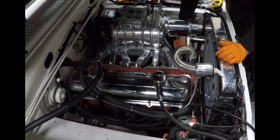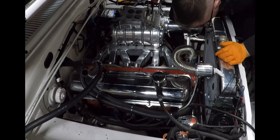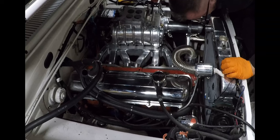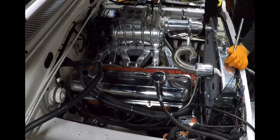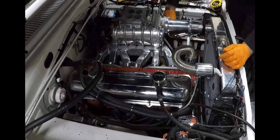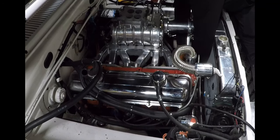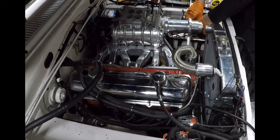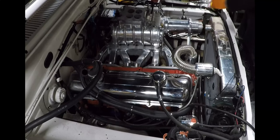One of the things we're doing is putting in the new radiator with a stainless guard. I'm doing a protective stainless guard across the back of the new radiator to make sure that if a belt pops off it's not going to chew through a $500 radiator. A lot of people don't do that, but it was common in old racing days — especially with people running blowers and big multi-V belt setups — they'd just run chicken wire on the back of the radiator. It's an old school trick but it works, and I've got stainless so it'll look better than ace hardware chicken wire.